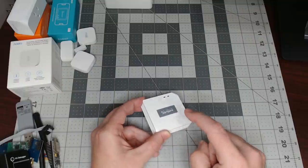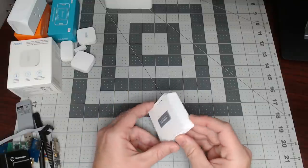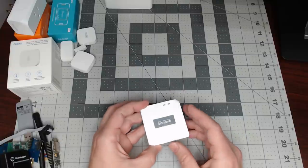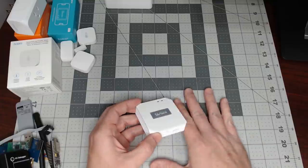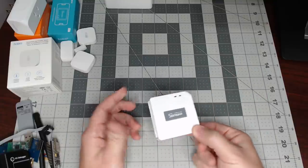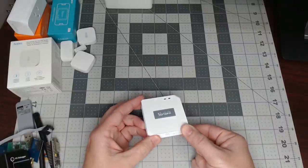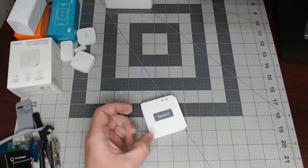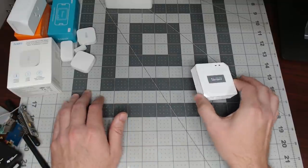I could place this anywhere in the house and create my Zigbee network instead of having to tie it to the Home Assistant server and then having to pass USB ports and serial ports into VMs and Docker containers. This is all using TCP straight into Home Assistant and it's pretty simple to do. No, Sonoff didn't send me any sensors to use with this unfortunately.